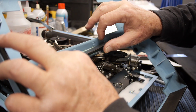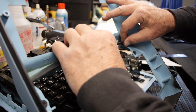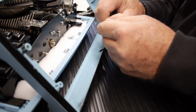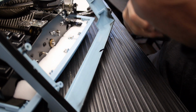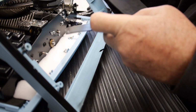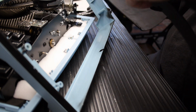I did add quite a bit of sound insulation to the machine. On the bottom panel below the chassis, I have a 1/4 inch thick dense rubber pad, and then all the hollow body spaces on the sides I filled up with urethane foam where I could, and in places where the tolerances were a lot tighter, like around the motor pulley and drive belt, I just used the thin adhesive craft foam, and also the craft foam I did put on the inside of the ribbon cover and other places where it didn't permit the thicker urethane foam. So a lot of soundproofing to help dampen the resonating plastic body shell sound, and it worked really well.